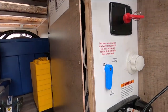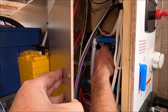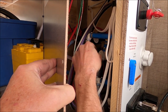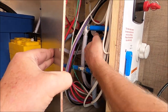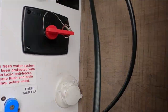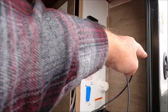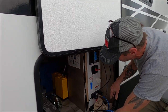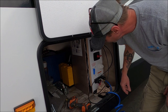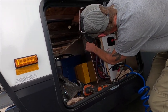Here's your line — you've got to turn the valve so that you can run antifreeze. This is your line coming to this valve. Remember line-of-sight — you've got to turn the valve in the back because you can't see it right now, but it's got a point on it. I've pointed it to this hose because that's your antifreeze hose. Go ahead and reach in there, feel that valve on the back. That's making sure that when you turn on the pump it's now going to pull from this hose rather than your tank.